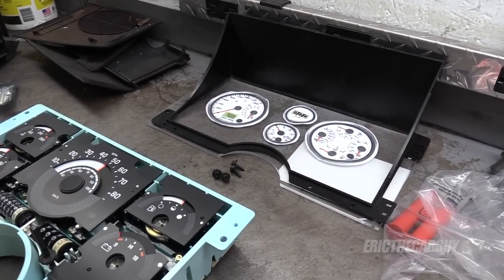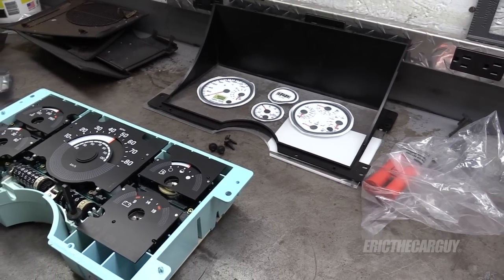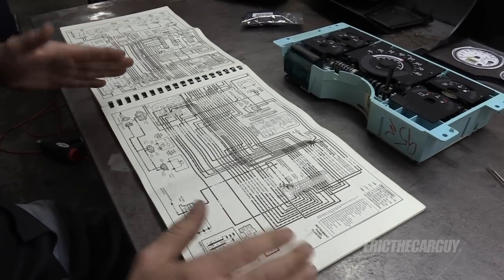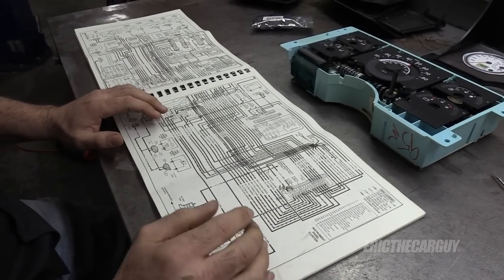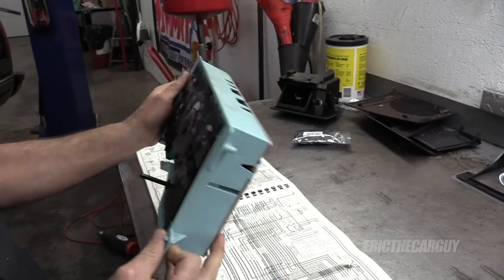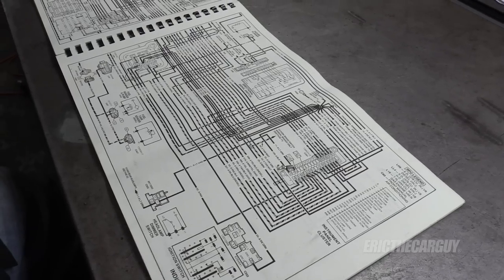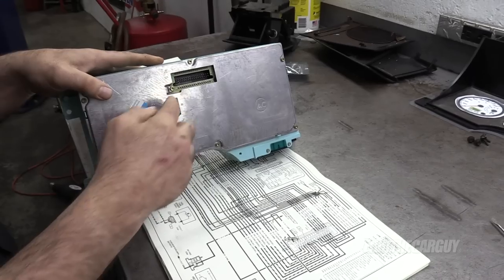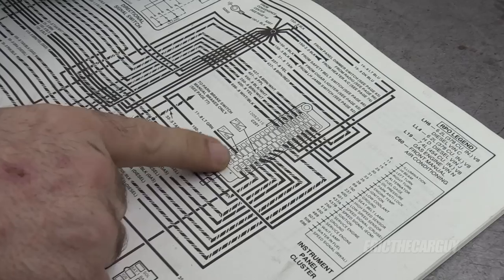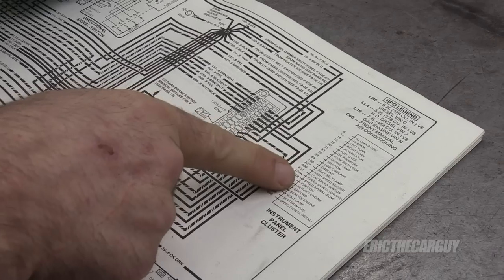Now that I've got that part of the cluster pretty well sorted out, I'm going to wait until the gauges get here to figure out final placements of things. But in the meantime, I can go and work out the electronics. I know the wires and things that I need — I've installed a set of these gauges before. So here I have the old gauge assembly and the schematic for all the gauges on the dash. This is going to help me figure out what wires I need to pull out of that connector and harness. This is where the connector comes into the back of the gauge cluster, and right here is the schematic for that connector. All these numbers represent different circuits, which are listed over on this side.